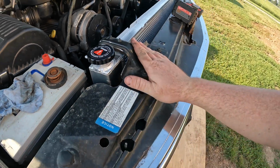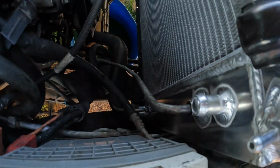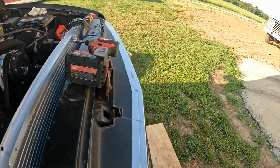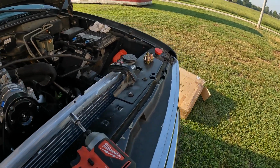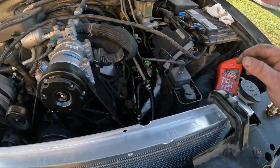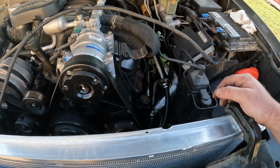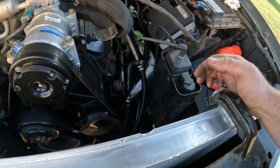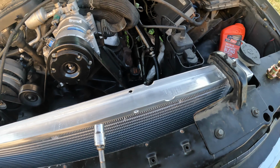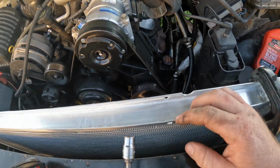These here are bolted in. Now I've got the tranny lines started in here. I test fit the oil cooling lines, so they do work. Probably what I'm going to do is get the oil lines put in, then start it and let it run for just a second, make sure after it builds oil pressure that none of this is leaking, so I know the fittings are right. Then we'll go ahead and put the fan shroud on, the fan on, and finish her up.